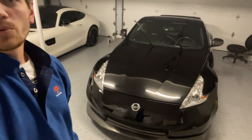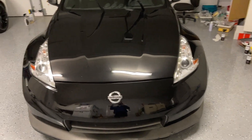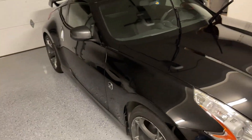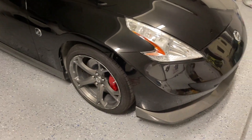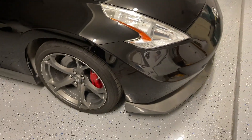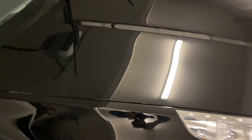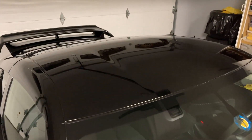Alright guys, I am 23 and a half hours into this detail. I've never detailed a car that's taken nearly this long — the previous longest was 16 hours. The car is looking really good. What's taking so long is I keep adding more to the list as I go through the car, and I haven't even really touched the interior. I did lots of touch-up paint, and there was some damage on the front bumper — the clear didn't dry as well, but in certain angles you can't even tell it's there. I did apply the Clutch Silica spray and I'm just going to wait until I get more light out tomorrow to buff that off.